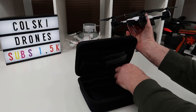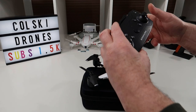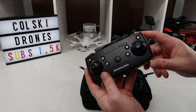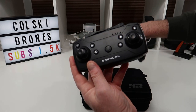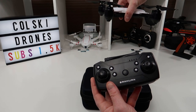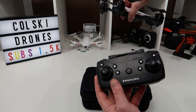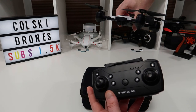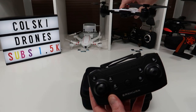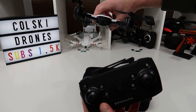It also has follow me mode and other intelligent flight modes. On the transmitter you've got a follow me button and an orbit button — they do not work. What'll happen is when it's in the air and you hit the follow me button, the drone will stay there but it just rotates with you, so you can't line yourself up in a shot because if you turn it'll turn with you. It doesn't actually get you in the shot. The orbit mode on mine was just flying off to one side, stopping somewhere, then flying back — I had no idea what it was doing.